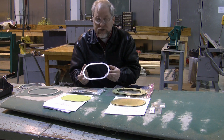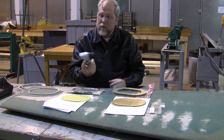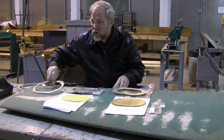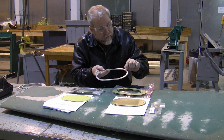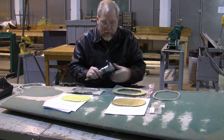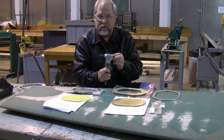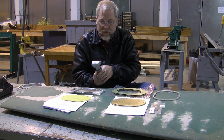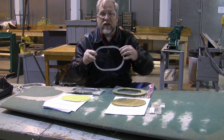These are templates that I've already cut out by looking at the instructions and making all the measurements. They've been CNC machined to keep our power nibbler from doing any damage to the airplane and only removing the material that we want it to remove. I also went ahead and cut in guide holes, which will allow us to drill all of our holes perfectly. Let me introduce you to the power nibbler — a friend has referred to this as a 'pissed-off, drunken beaver.' It grabs chunks and removes them, spraying aluminum everywhere. It cuts really well but is hard to control, and that's the reason for the CNC cut templates.